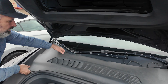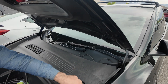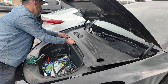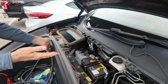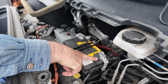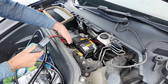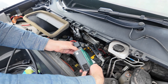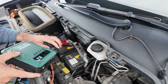To access the low voltage battery, pop off the cover — there are a couple of clips across the top and sides, so pull straight up and they pop out without tools. This exposes the 12 volt battery. There's a negative terminal indicator and a positive terminal. Attach the jump pack's negative clamp to negative and positive to positive. A light on the unit shows 'correct' confirming proper connection. Then press the boost button.